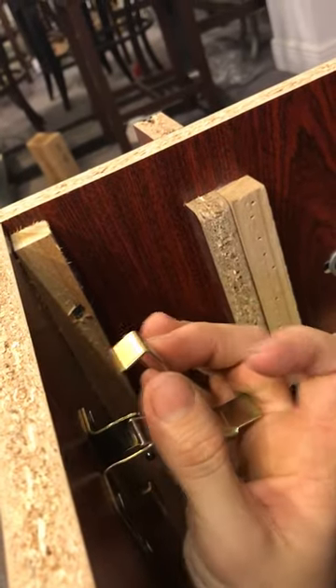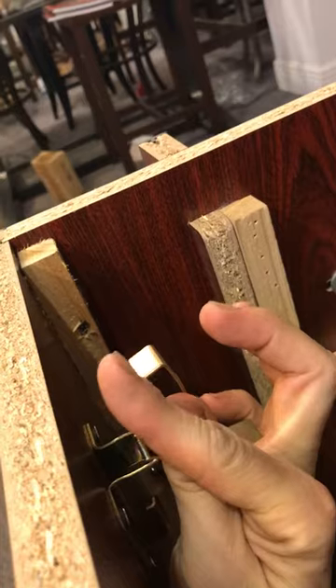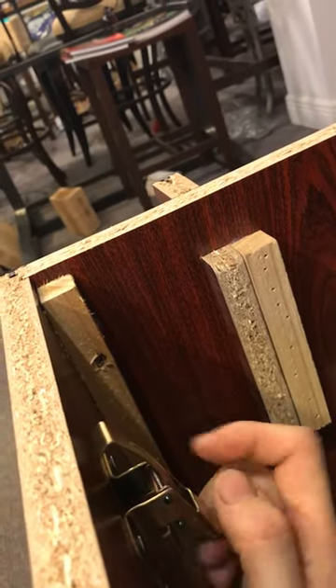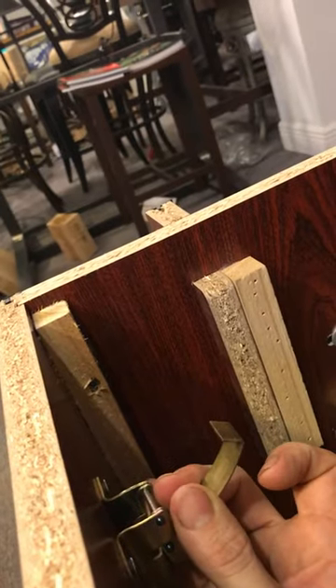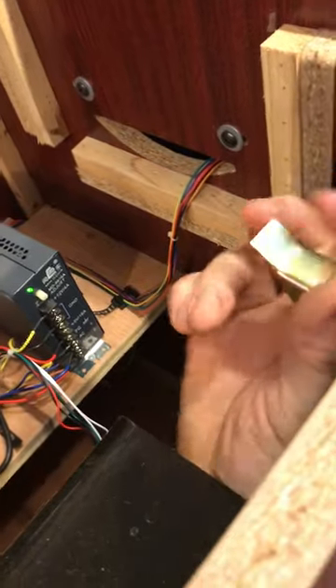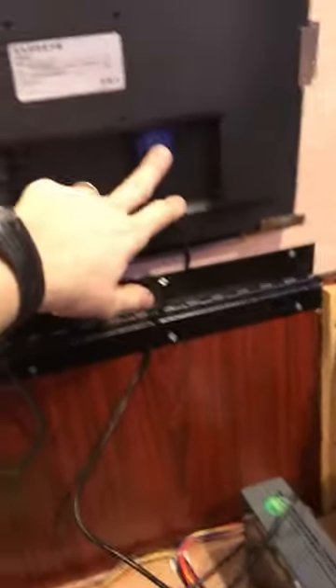If it is locked and you're reaching on the inside of the machine, get down, put your hand in, and feel for the latch — it will be in the locked position. Reach up and pull it up. You'll also want to grab this and pull it back because it's hooked under this hook here, locked in the down position. Lift it up, pull it back, and the top will open. Do the same thing on both sides — all done from the front of the cabinet. Once both hooks are pushed up and pulled back, the lid is able to release.